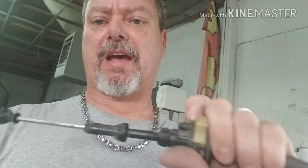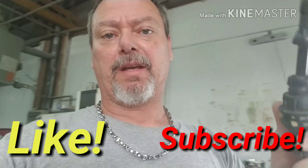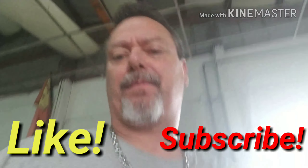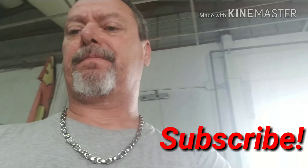I'm going to show you how to do that today. This right here is my old shifter cable. This right here is just a slide, and what you need to do is crawl under the vehicle — I just pry this up with a little screwdriver, slide it up, and then this thing adjusts. This slides back and forth along this cable, and then you can lock it in place wherever you need it to be.